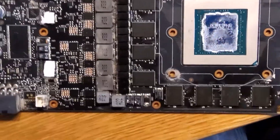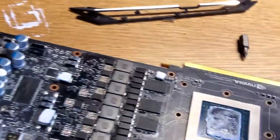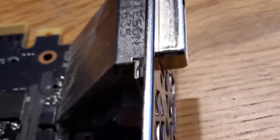So I've got some unpleasant news. When I try to put the cooler on, there's no Titan X cooler — I just got the 1080 Ti version. If I try putting it on, you can see it slides slightly to the side and it's not on the chip exactly where it has to be — it can't go there.